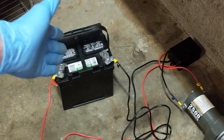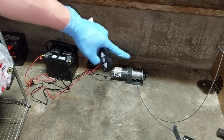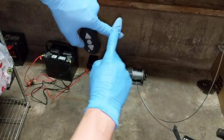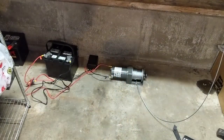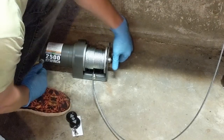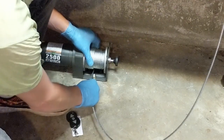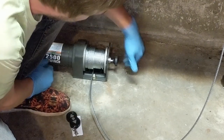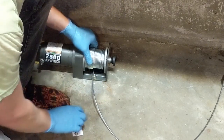With that our winch should theoretically be able to power up. Before you ever try to use the winch make sure you have the clutch engaged — it's on the right side. You basically just pull the knob out and turn it 90 degrees. There's a little pin that sits on it so that it doesn't go back in. When you want to engage the clutch you turn it and let the pin sink back in, pull the cable, and you'll hear a clunk — that's when the clutch re-engages. Right now the clutch is engaged; you pull this out, you see that pin pops up, turn it, and now the clutch is not engaged. That's when you can freely unspool it. To re-engage: pull out a little bit, turn until it sinks back in, pull the cable, and you'll hear that snap — that's when it's back in.